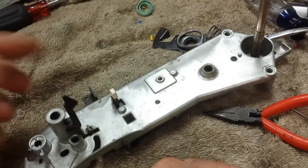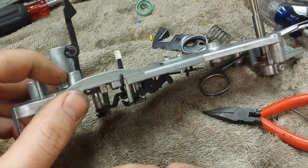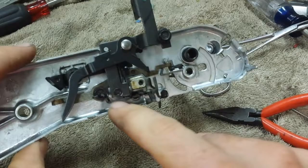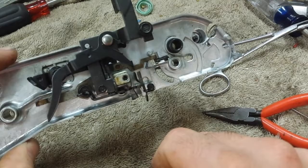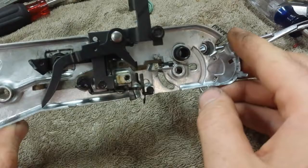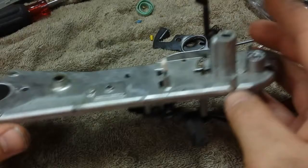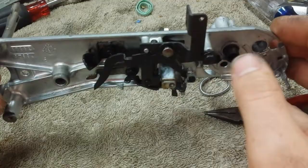This is starting to get sticky too, so I may want to take care of that — it's also under spring tension, attached behind here and then to here at this point. So just take your time with it, make notes as you take it apart, and that's a more thorough cleaning service. You can get to all the common stuff that we showed you in the other video regarding the basic service on the VM. Just clean and lube all this. If you've got an ultrasonic cleaner, you can use that. Some people use oven cleaner, some people just scrape with tools and then clean the rest with alcohol — that's what I commonly do. But that's the more advanced part of the VM service, and I hope that this is helpful to you.